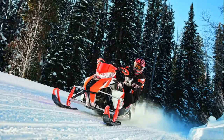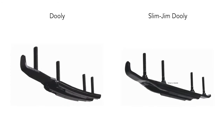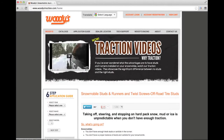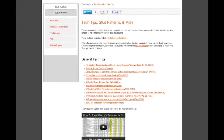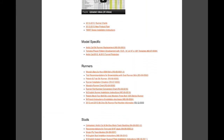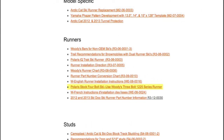The trade-off to achieve the more aggressive turning is it may increase your steering effort. Although the dually and Slim Jim are not available for all models, they will fit most current model snowmobile skis. On our website, we have a tech tips area to help you with your runner selection. For example, one set of Polaris stock skis come from the factory with either a 3 or 4-bolt runner, but all Woody's replacement 12-25 runners for Polaris skis will only have 3 bolts. Review our tech tips to see if one applies to your snowmobile ski.